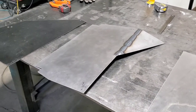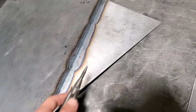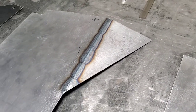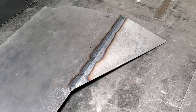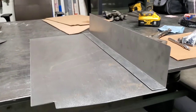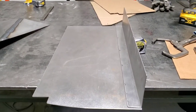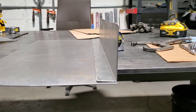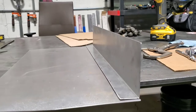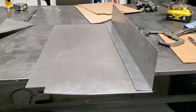This was my first attempt at the rear shield — 12 inches by 24 inches long. I welded on a triangular piece to protect the sensor wire area, but from my limited perspective sitting underneath the truck I thought that was going to provide enough protection, and it doesn't at all. So the four-inch lip I mentioned would protect access from the side. This is my new shield — we had this piece of sheet metal with a one-inch lip bent at 90 degrees from a previous project. I cut it to four inches wide and now I just need to stitch weld it onto the plate, and that will be my rear shield.